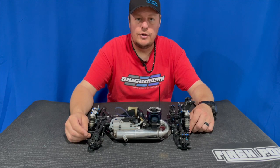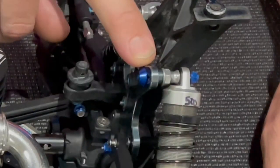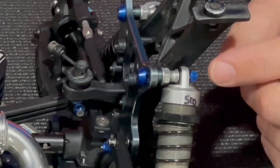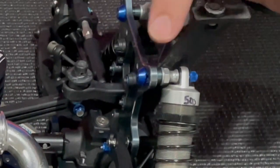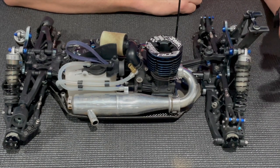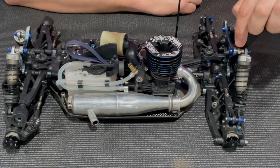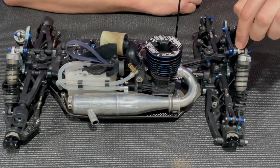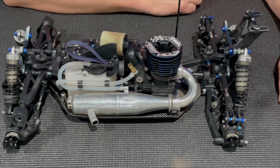Here's what we're referring to as the upper rear shock standoff. You will need to get a three by 30 millimeter cap head screw because when you shim this shock standoff back, with the stock 25 millimeter screw you won't be able to get the nut on unless you switch to the longer screw. As for the washers, these are just Mugen parts — the three millimeter washer is H0181 D-G and the two millimeter washer is H0181 C-G.